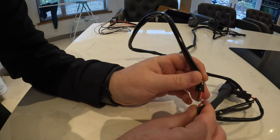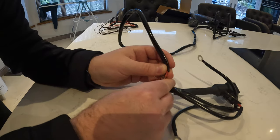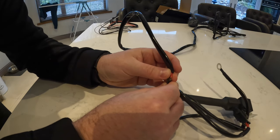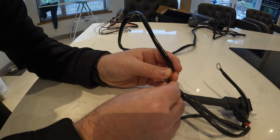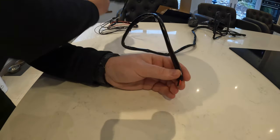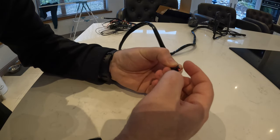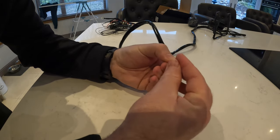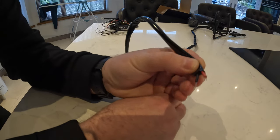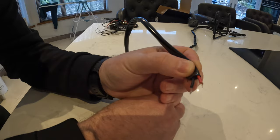Now that the switch is gone, you're left with pretty much your negative and your positive wire coming into the loop that goes to the battery and the fuse and so on. I'm not going to need that either, so I was able to take that away. In the end, very simply, what I'm left with is the lights running down on a negative and positive, which is then going to be fed through the bike into the Hex Easy Cam.